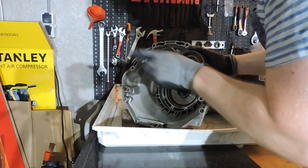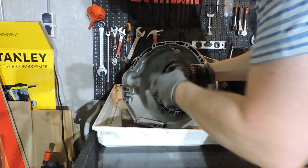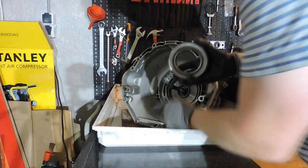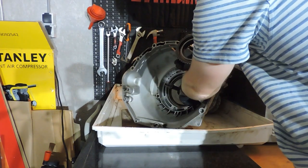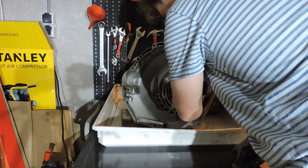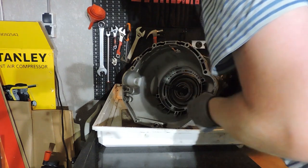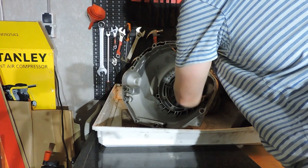And you can identify the way you can put the sprag bearing in. Not only do we have the clockwise counterclockwise trick, which is now from the other side, roll counterclockwise, block clockwise, but you also see that the smooth surface right here has to sit over the smooth surface right there, meaning that the geared surface grabs into that geared surface. So that's how you are sure that you put the sprag in the right way. It sits nice and tight right here. Let's check again. Turns counter, blocks clock.